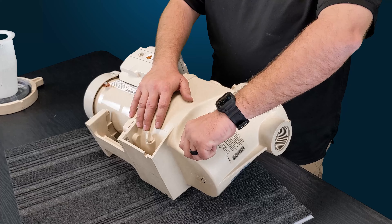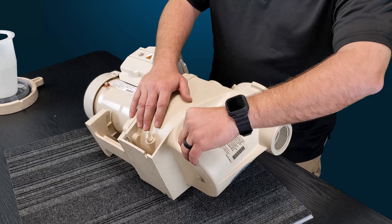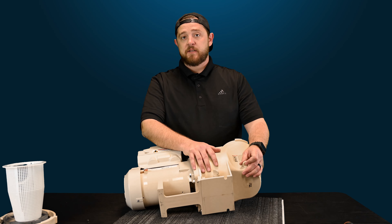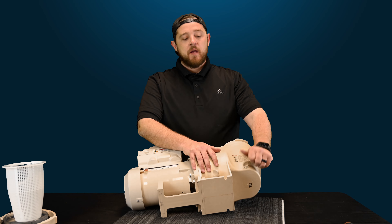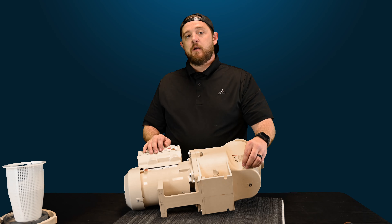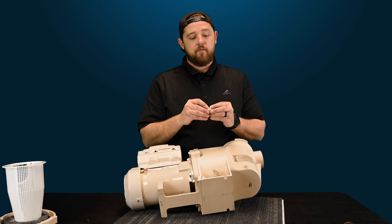It's really important that when you pull them, you pull both — don't just pull one and leave the other because there's going to be water sitting in there causing those same issues. They come with O-rings already installed, so you don't need to buy a different O-ring. It's just a basic thread, so you're just going to unthread them. Depending on how long they've been out there, they may be stuck, so definitely grab some pliers and maybe throw a rag over it. Because this is plastic, the last thing you want to do is eat it up and cause problems. These O-rings are going to seal everything up for you.